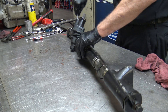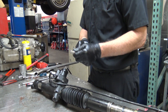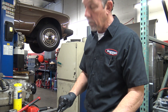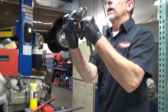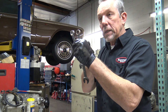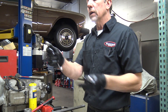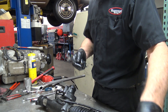You want to use, in my opinion, a tubing wrench. Just so you know what a tubing wrench is — instead of a full box on the end like a normal boxed end, there's a gap, and that's so you can get it over the line too. You also notice it's got a lot more beef around it. Since it doesn't have that connecting part, if something is really tight it's going to spread. They're usually a lot thicker all the way around. Even the open end, if you look at it, it's much beefier — it's designed not to spread out.